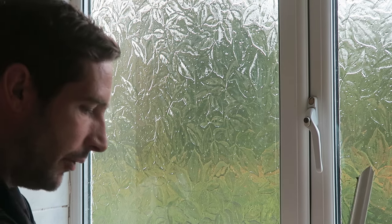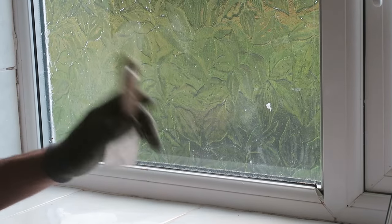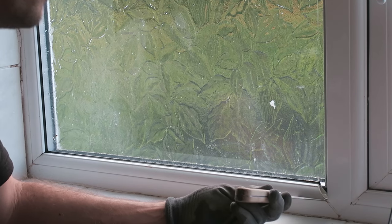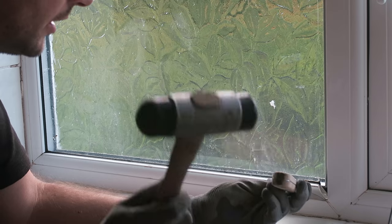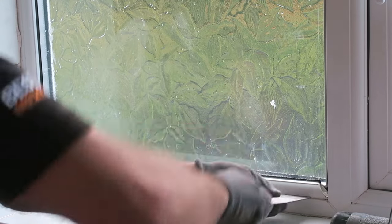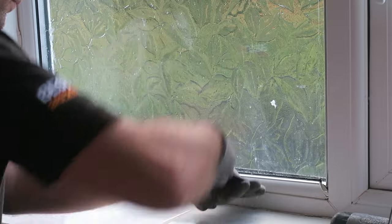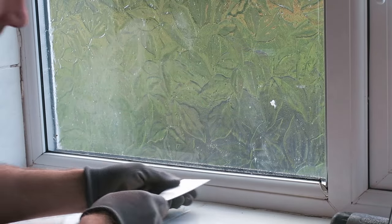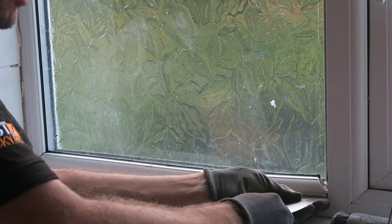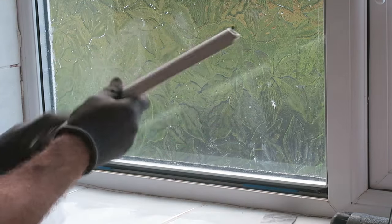You want to keep them in the right position so they go back exactly where they came from. So the bottom bead — because there's no bead here now, we can release this upwards. We just want to get in this corner here. Same again, corner of the pallet knife goes in there — not flat like that because it's going to be harder to knock in, so just right in the corner, just a couple of taps again. Flatten your pallet knife and then with an upward motion release that, and keep pressure on continuing across like this until we've released it. Now we've got it up a little bit, we can just flick this out, and then work it out once we've got a gap. So we've got this coming out underneath the whole bead now — then we can just flick it up and pull it out. That's our bottom bead out.